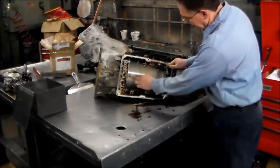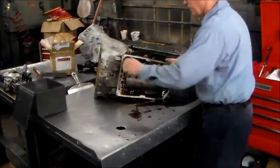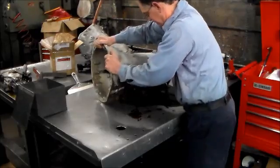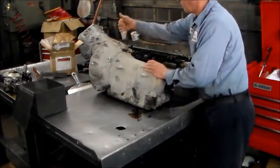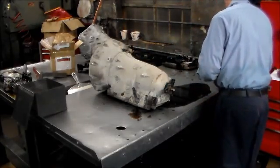Now in the case here you've got your N2 and N3 speed sensors — that's where they read. We're going to flip this up. To get the bell housing off, you've got bolts on the inside and two bolts on the outside, one on each side.